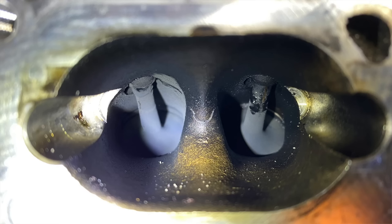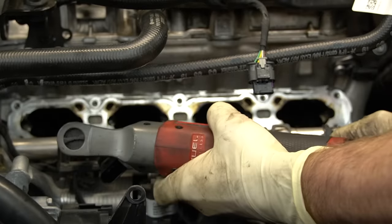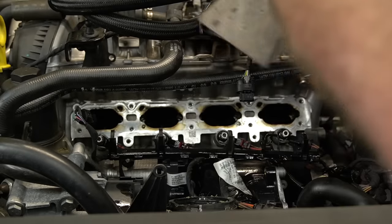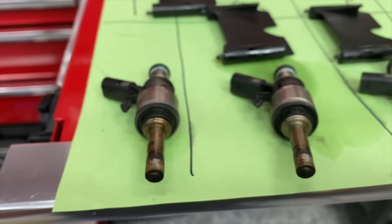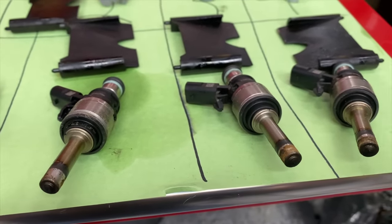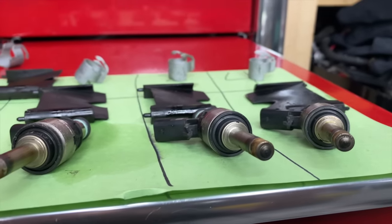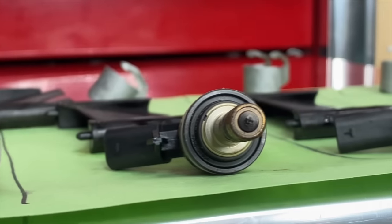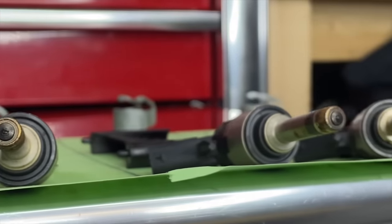This was the before when we put it back together, and now here we're looking at the after. Let's go ahead and pull the fuel rail off and take a look at the injectors. With all four injectors out, the top-down view doesn't look all that bad — there's some crust on there, but we kind of expect that since this section lives in the combustion chamber. As we look at the tips of the injectors, we can see there's some crust built up, but it's really not all that bad. Cylinder two might have the most. I kind of expected them to be worse than they are.